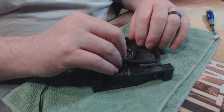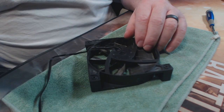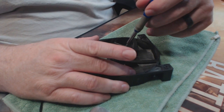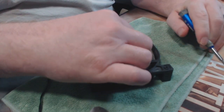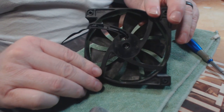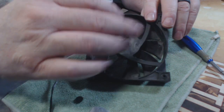With these fans — they're fluid bearing fans typically — it's not necessarily the motor that's bad. It could just be that there's no oil in it. You can peel the sticker right off, and usually there's a little port underneath with a rubber plug you can easily get out using something small like a flathead screwdriver. That will expose the motor, the shaft, and the fluid bearing.